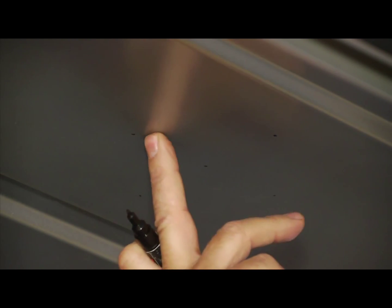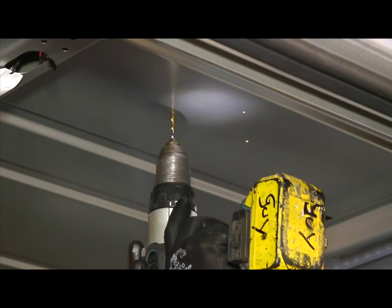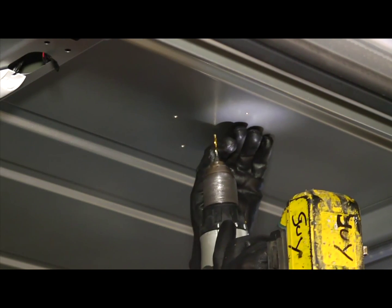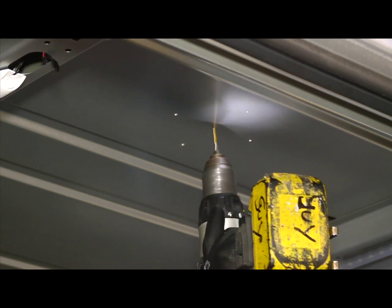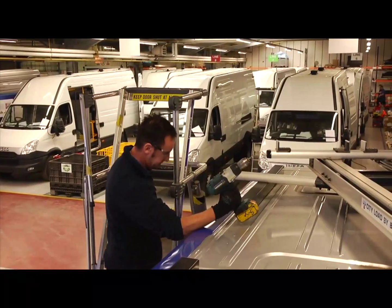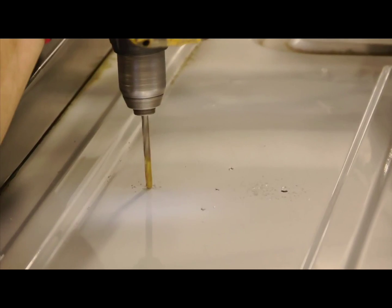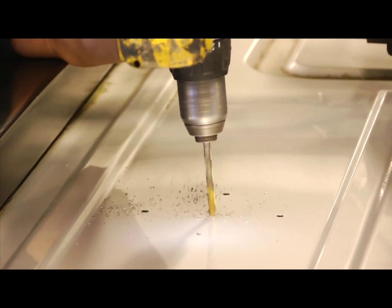Do not fit it to a large unsupported section of the roof. For best results, we recommend the addition of a passive inlet air grill set low down inside the vehicle. Don't forget to wear safety glasses for this next stage. Using a 3mm drill bit, drill five pilot holes in the roof of the vehicle. Next, open up the four fixing holes with a drill fitted with the 5mm drill bit. Finally, open up the centre hole using a 6.5mm drill bit.